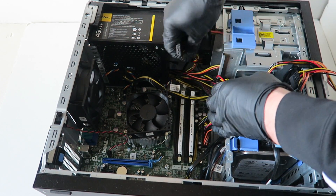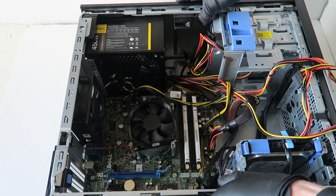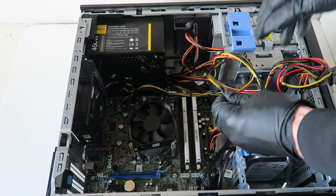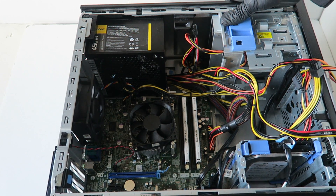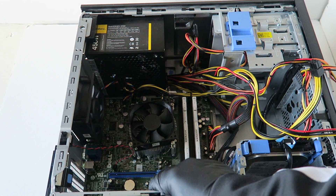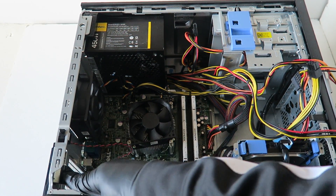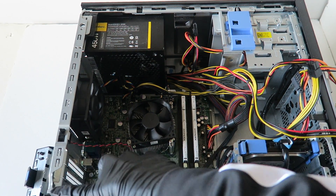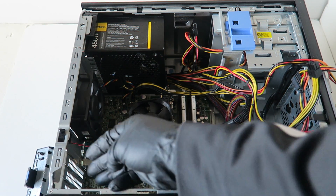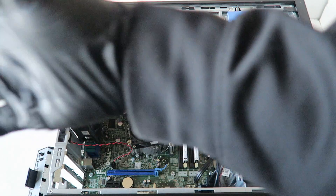What you guys have to do is use cable ties to make it nice and neat — get the cable ties for wire management. Now we're going to install the video card. There's a little clip right here: press it down with your finger gently — that's the PCI bracket secure clip. You're going to remove two PCI brackets right there.